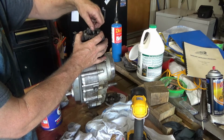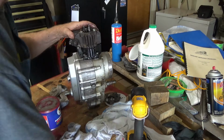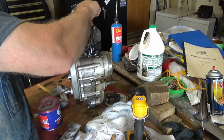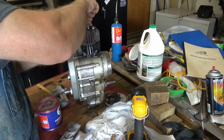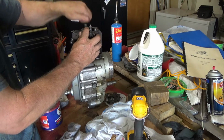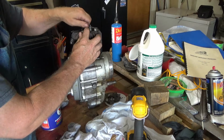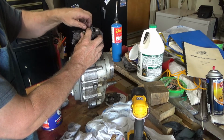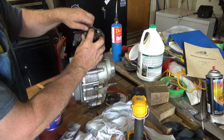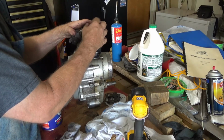I'm just going to put it down enough that the rocker arm's not going to come off. I'm going to guess that that's too tight right now, but I would rather not drop a rocker arm on the floor. I think my battery's getting pretty low. Two thousandths and 3/1000ths is the clearance I saw in the book when I was looking. These are the lock nuts. I'm putting them on now, so I don't want to lose them.